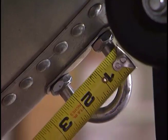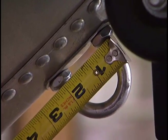With the winch mounted and the guidons mounted, now you may install your bow latch. The bow latch replaces your eye bolt. The eye bolt is specific to your boat. There's two different sizes, 1¾ inches and 2 3/8. You must first identify which size you have and pick the correct one when purchasing a system.